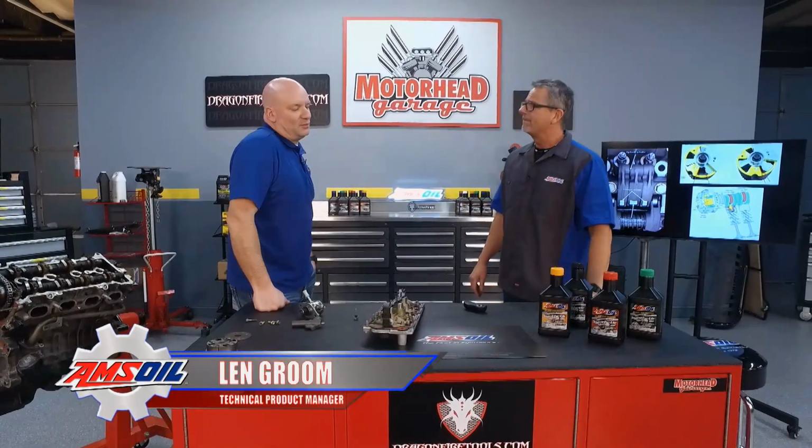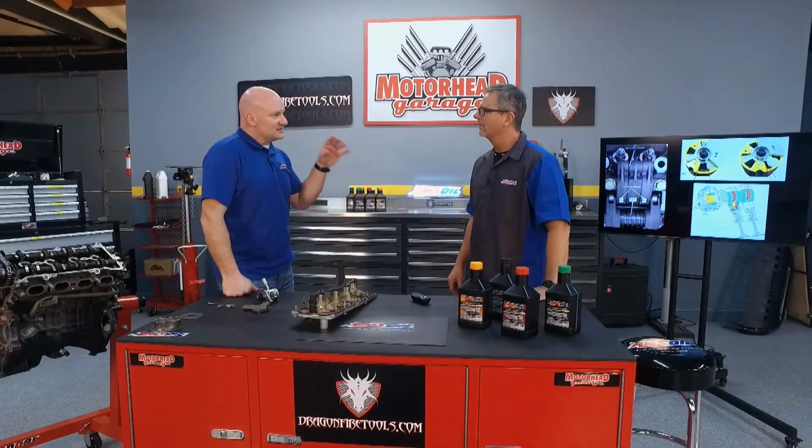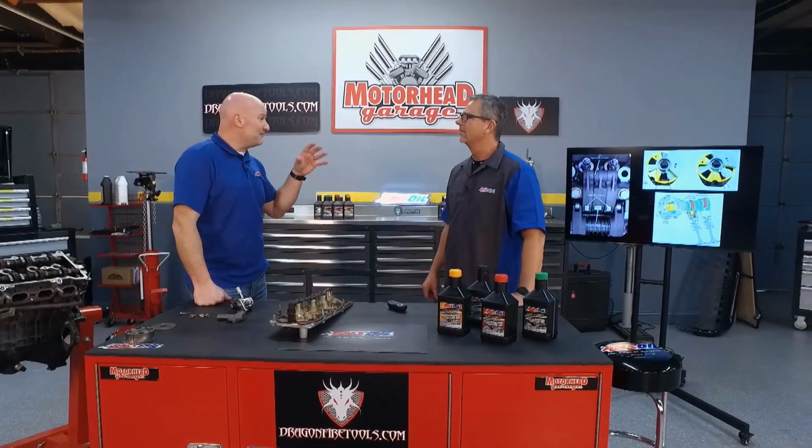It is. And one of the things we're talking about here, we've got many, many different viscosities, but what we're looking for, when we look at all of these different technologies, is consistency. Oil is affected by temperature, and it's directly related to oil pressure. And we need consistency. So building the oil properly, using the right additives, using the right base oils, most importantly, provides the consistency that you need to operate all of these different technologies the way that they're designed. And that's the key word there.